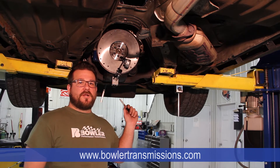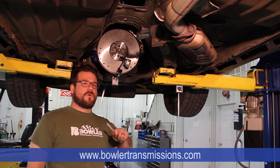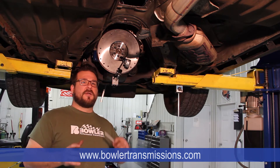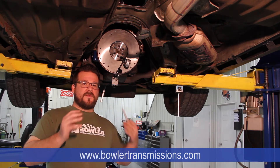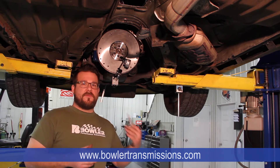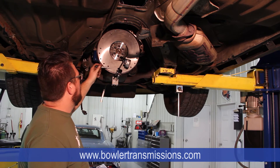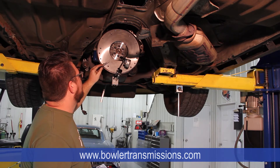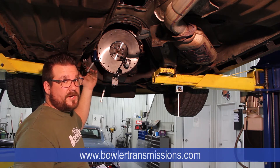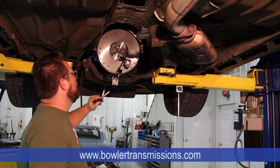As you can see, I've got the dial indicator set up right now to check flywheel runout on this particular engine. One disclaimer: through watching this video you'll notice a lot of the little detail parts I'm leaving out just for time's sake, but the whole purpose of this video is getting the theory down and giving you a better idea of how these procedures are done. With flywheel runout, we're checking how true the flywheel is to the crankshaft — making sure that, say, an original cast iron factory style flywheel is as true as an aftermarket billet unit like this particular one.